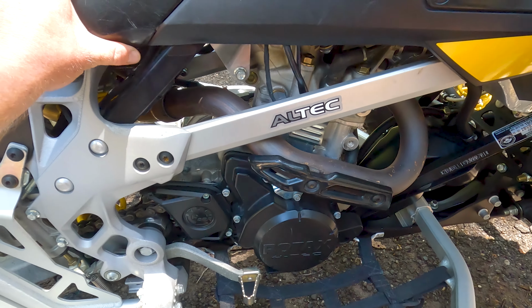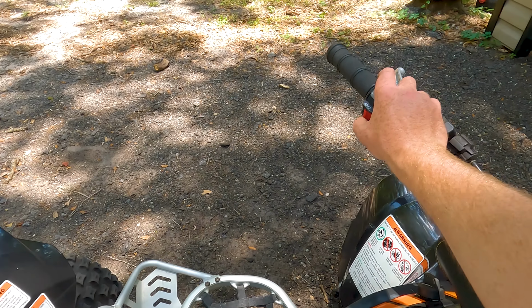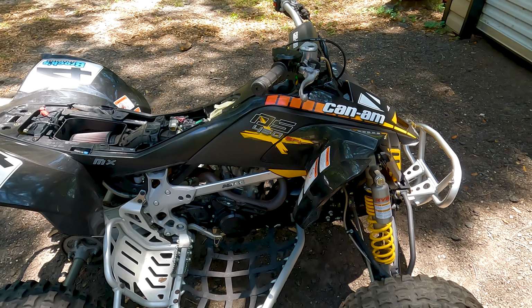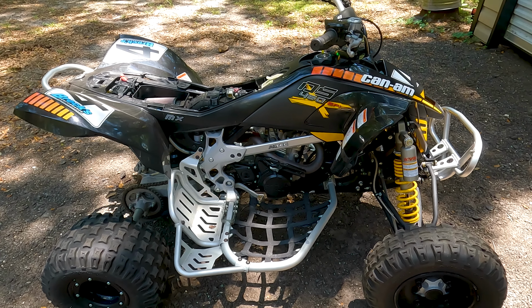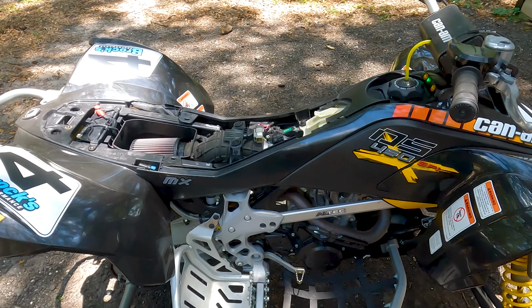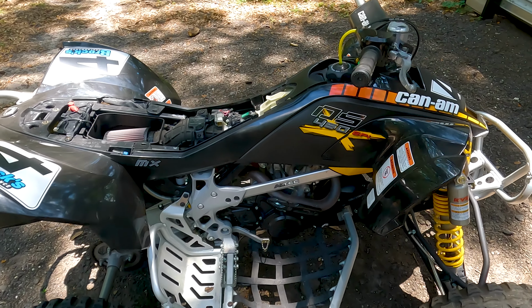Screwed the plug back in, snapped the cap back on, I hit the starter, and after about 10 seconds, pop, pop, pop, pop, pop. It ran for about 3-4 seconds based on the starting fluid that was able to vaporize in there. So I knew then I had good timing, I had good strong spark,